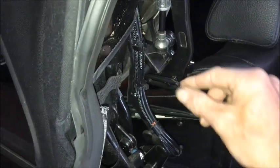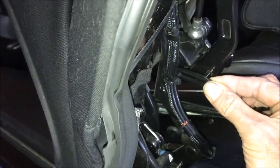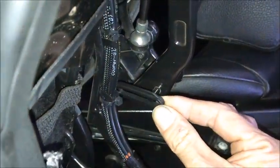Right here is that sensor and it's out of position just a little bit. Watch — if I move it and pull it down just a little off the tab, you'll see it moves to position five. If I pop it back on where it's supposed to be, it moves back to position six. So that's definitely the sensor causing our top faults as we're going down the road.